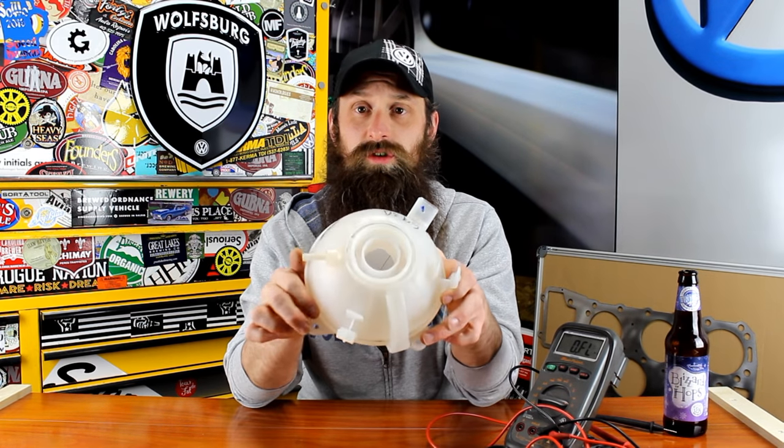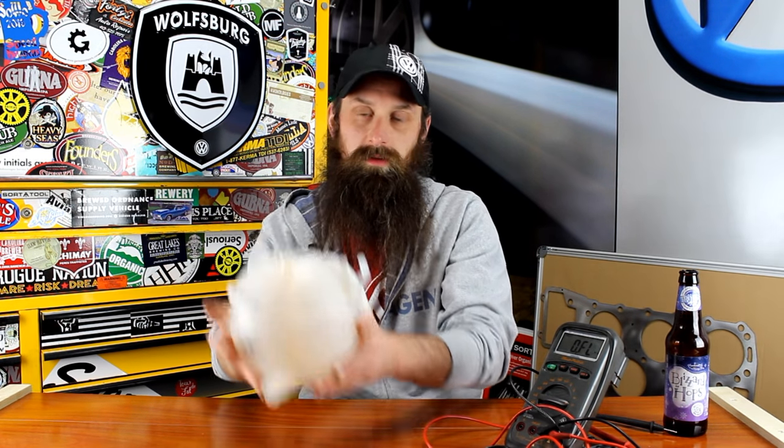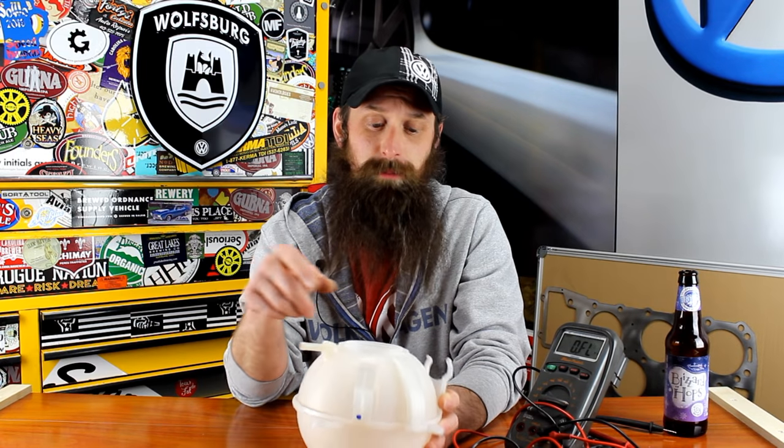Is this a DIY part? Absolutely — these are really easy to put on. It's two screws, two hoses, one connector, and you might have to move a wiring loom depending on the model. The Beetles are a little bit tricky — I think you pull the washer fluid jug out of the way to get the bottle out. You will lose some coolant, obviously. Just make sure you don't leave a puddle of coolant on the ground — it is not safe for animals. For some reason Volkswagen doesn't put that bittering agent in it, which is really surprising.